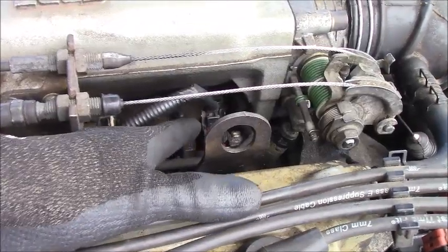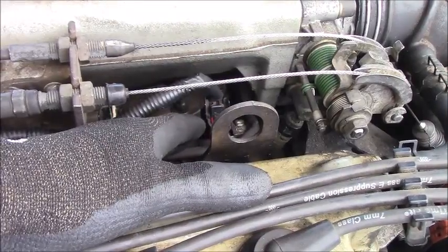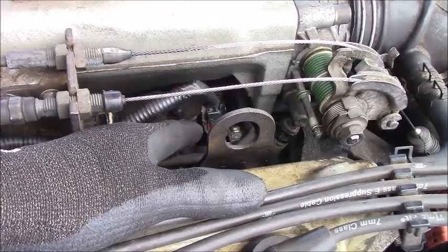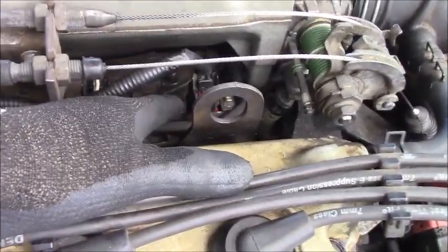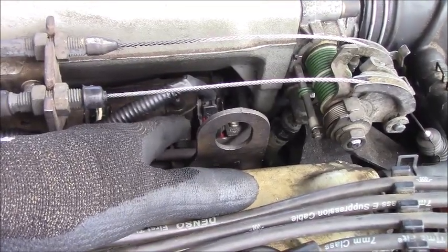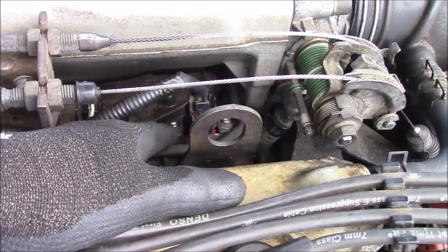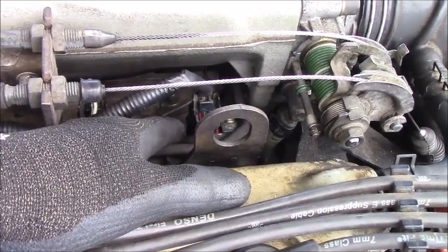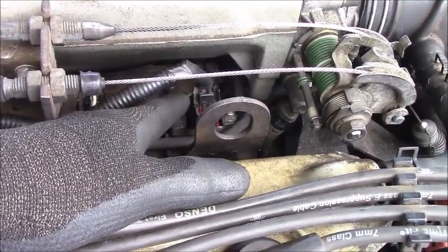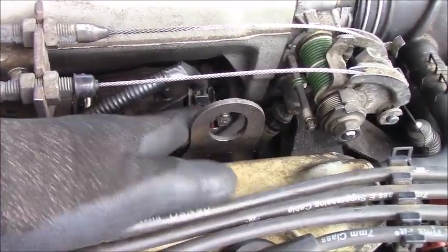When you put it in, you have to press the new fuel injector down all the way to get the O-ring into place. If you think it's hard to press down, and you put the cap back on and think the screw will do its job and press the fuel injector down for you, you might get a problem with the O-ring broken, okay?